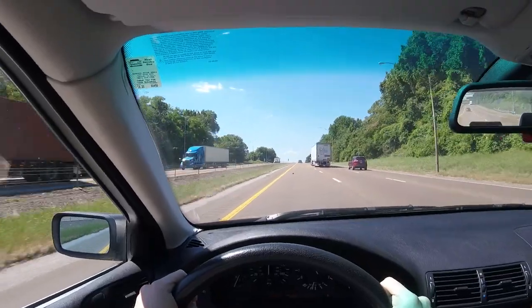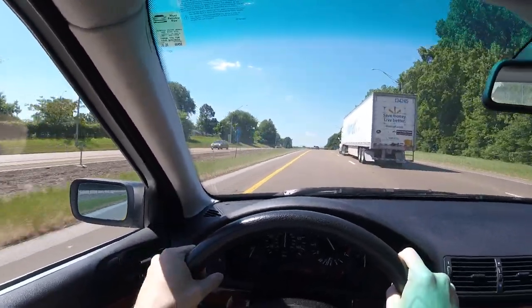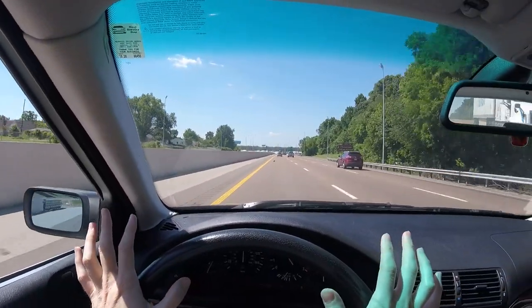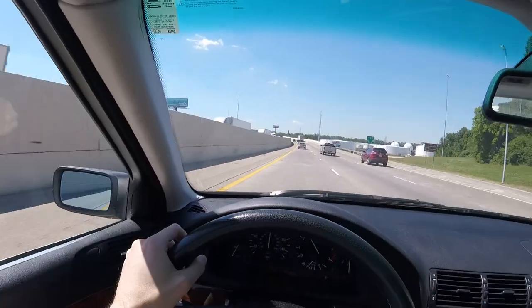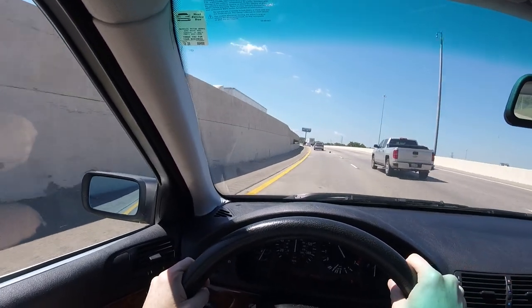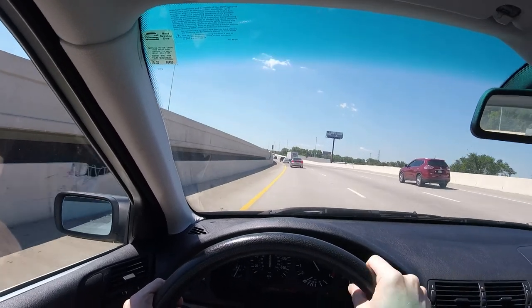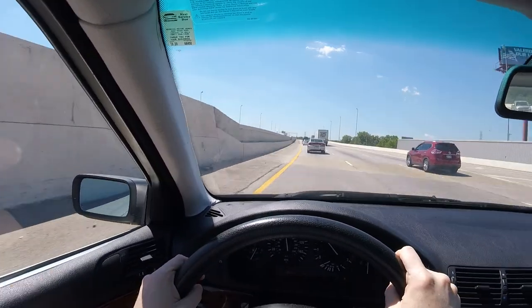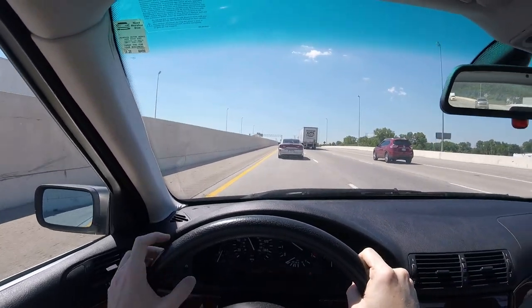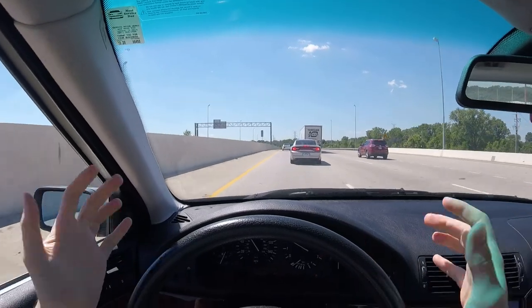And then Mike called up there, who loves my car and is a diehard Mini fan. "Let's do something real special. We got an opportunity to make this car better than factory. The intake exhaust valve stems on the Cooper S are pretty small, and since we got to replace them, why don't we go with the JCW valves? They're a little bit bigger. The head's got enough room where we can go in and port out the cylinder ports to make it a little bit better, and that's really going to open the car up."